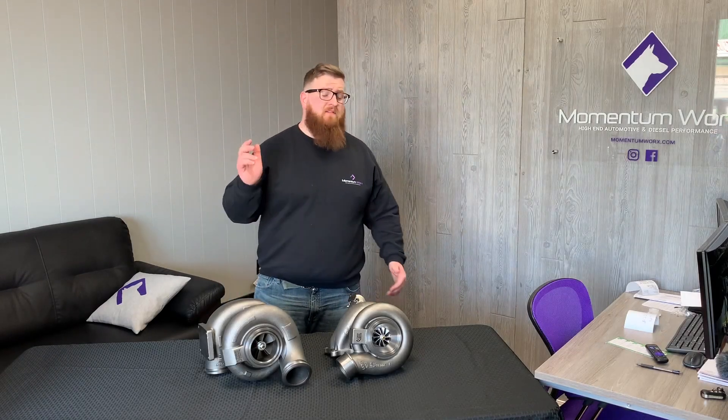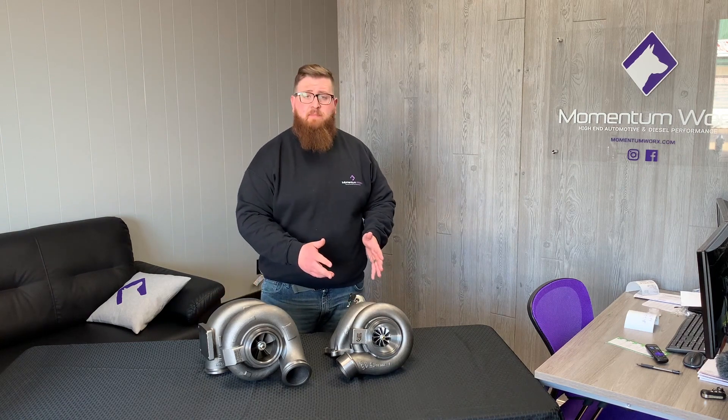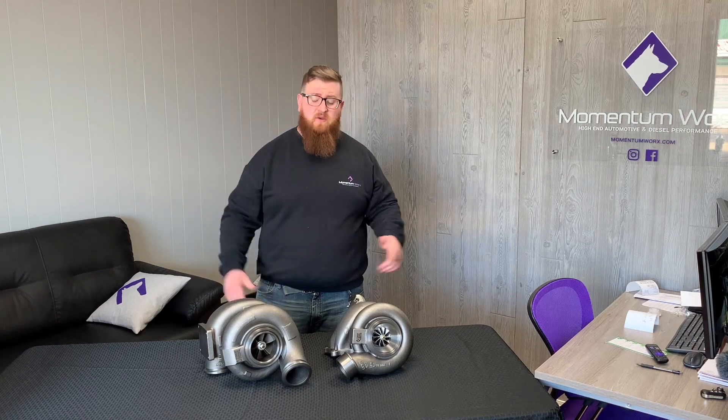So just to recap — if you have a BXS, NXS, or NXX C15 Acert, these are the stock replacement turbos for your truck: your low pressure and your high pressure. These are a direct replacement — everything lines up the same. They come with a one year unlimited mileage warranty, and what's nice is these are new, so you don't have to send in your cores, which can be very expensive due to core grading. It's all new components. If you're looking for a set, feel free to give us a shout, call us, shoot us an email, or drop a comment below. We're also going to have another series on the SDP turbochargers and how some guys use the SDP high pressure as an upgrade — that video is coming soon. Thanks for watching.